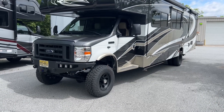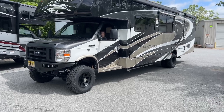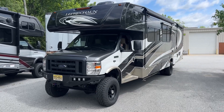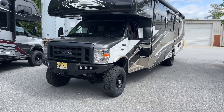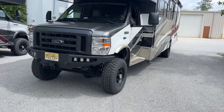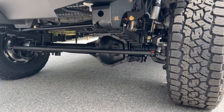Normal recipe for everything on this: 6-inch lift, custom spec springs front and rear, 33-inch tires. I had to educate a guy on Facebook this morning who said it's not possible to lift a vehicle and make it drive better — and I have to strongly disagree. These things leave the factory from Ford and go right to the RV manufacturer, who puts all this weight on the chassis and doesn't do anything to the suspension. They might do airbags, sway bars, or upgrade the shocks, but those are all band-aids for a rig that is grossly undersprung. By adding the proper spring capacity, better shocks, better steering angles, and sway bars, it is 100% possible to make these things drive 100% better than stock.